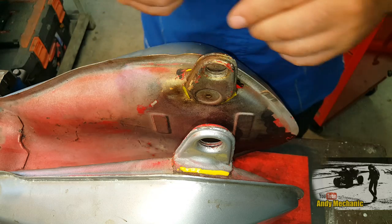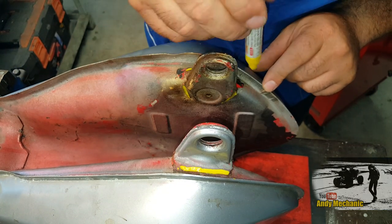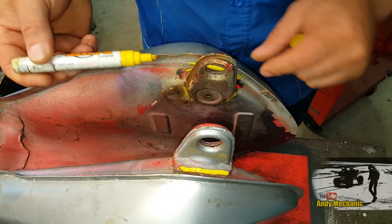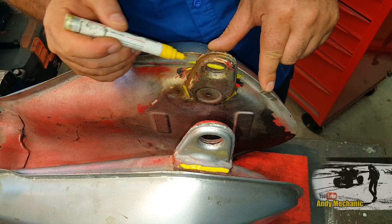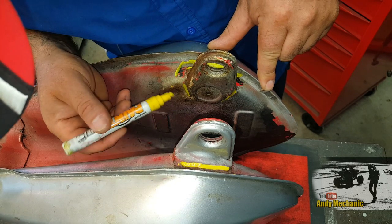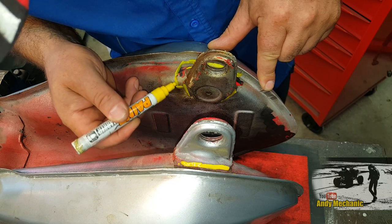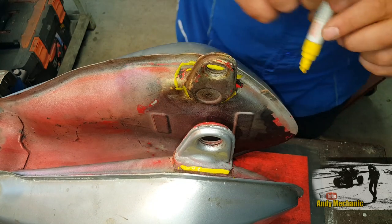And the part of the tank that I'm looking to replace will be around this area here, not quite up to the seam. I'm going to be welding just this side of the seam, I think, but if that's real thin, then I may have to weld on the seam, which I'd rather not do. And probably going to come around somewhere like this. You can see there's definitely a stress crack down there, and somewhere around this height. It's more on that bend. I think once we get into that weld there, there's no flex, and there won't be a problem.